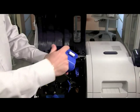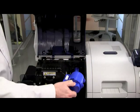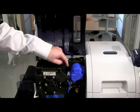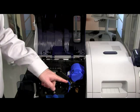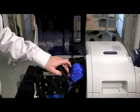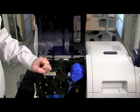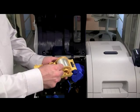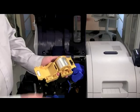Now we will load the bottom laminate into the cassette. Yellow to yellow — always verify that we have a match in the colors. It is exactly the same process as the top: load the roll into the cassette, close the cassette, trim the edge, then verify that the edge is not protruding from the lip. Install the cassette onto the spindle, twist into position, and verify that it latches. Now that we have the top and bottom laminate loaded, close the cover.